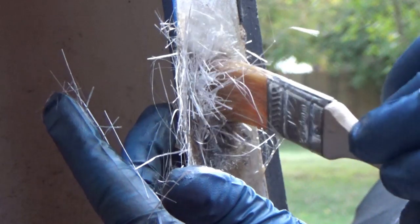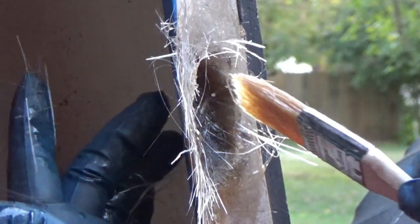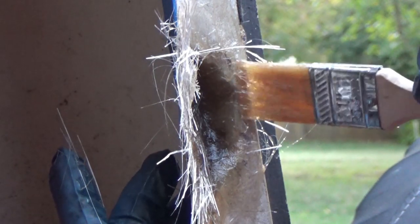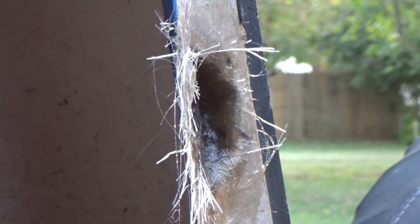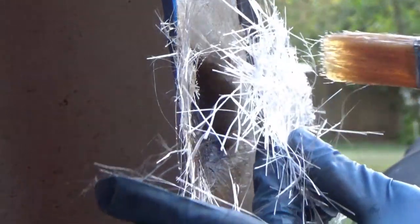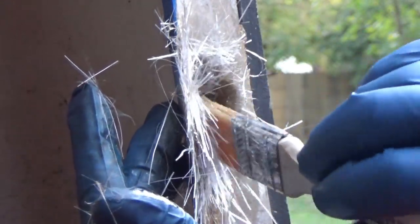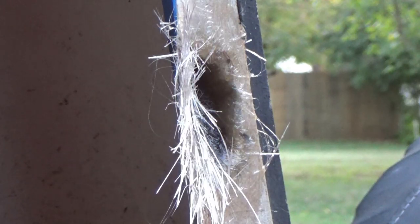The catalyst that comes with that kit is a slow cure - we're talking it took hours for the glass to cure. I'm just not used to that; I'm used to industrial-style fiberglass that cures within minutes. I was almost to the point of thinking the kit was bad, but it turns out it's just a super slow cure. For newbies - people who've never dealt with glass before - that super slow cure is actually a good thing. It gives you time to work with it instead of going 'oh crap, now what do I do, I wasted a bunch of glass because it cured on me.'